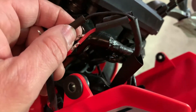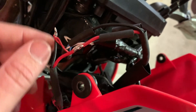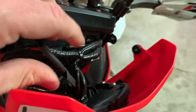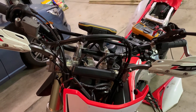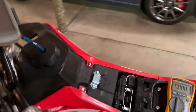All that's left to do now is to slip all the heat shrink down into place over the leads. I've got to slip one over top of this one since it's going up in the bundle, then slip the larger piece of heat shrink down over the whole thing, seal it up, close this up, and I am done. Let me show you what it looks like when it's wrapped — and here I'll test it to make sure everything is working.